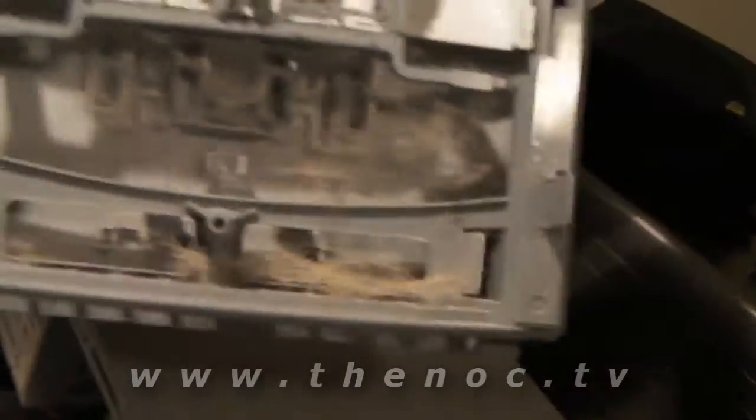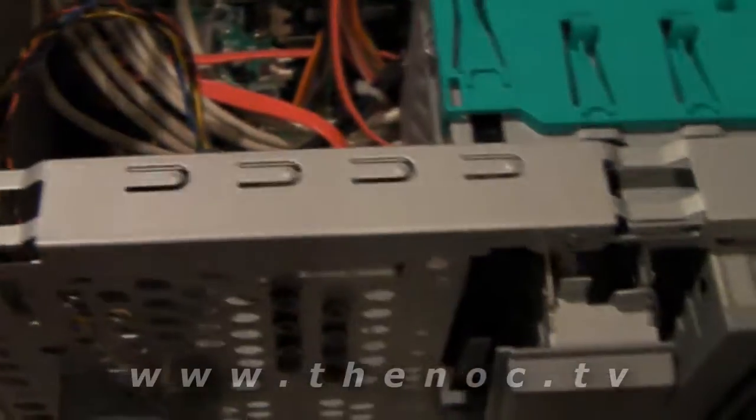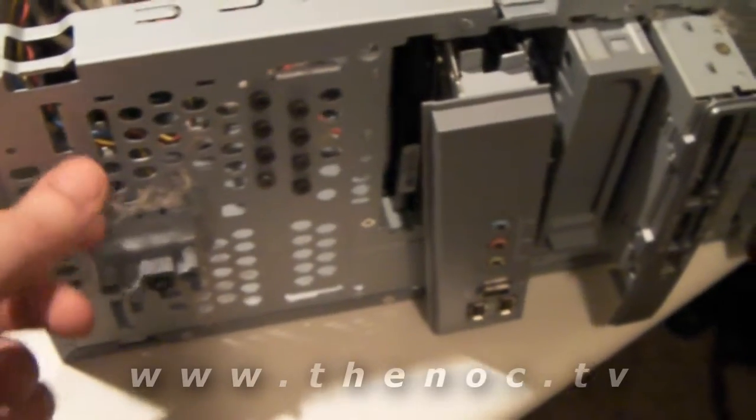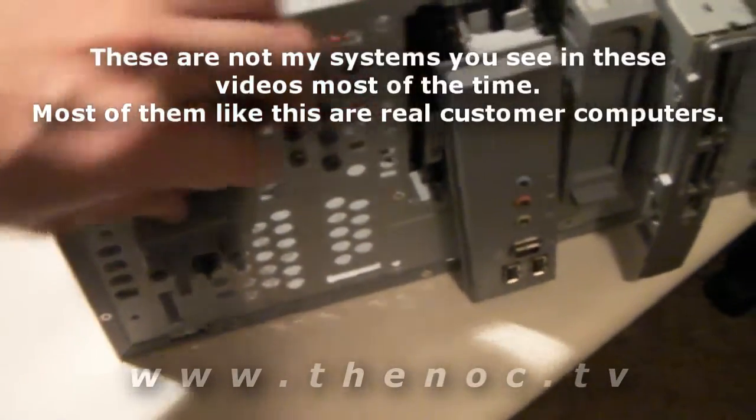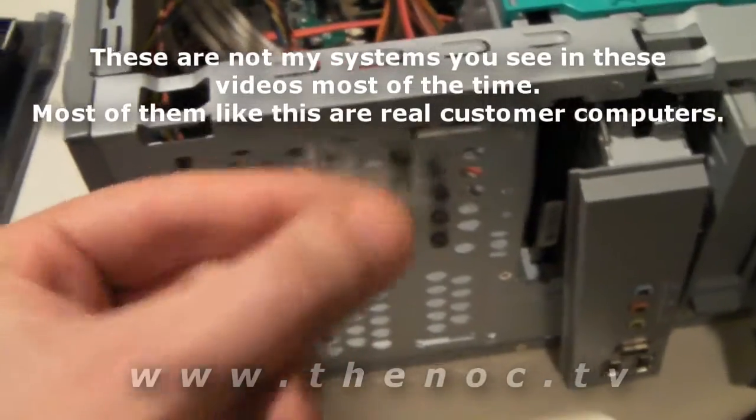Here's an inside look at one of these HP front covers. As you can see, there's no ventilation on the front — the only thing you have is on the bottom. You can see it's got a little bit of hair in it, not too bad. That's how your air gets into the front, so you just go through and scrape this out. Most of these HPs want you to take the front panel off. This one's not too bad — I'm actually cleaning it up to help reduce some of the issues I'm seeing on this one for a customer.